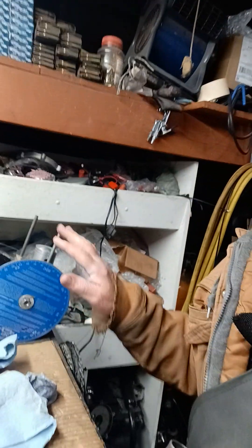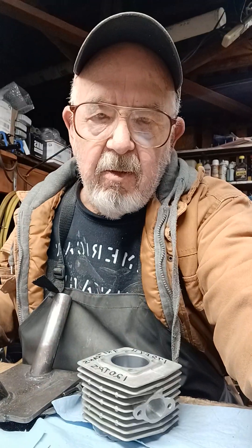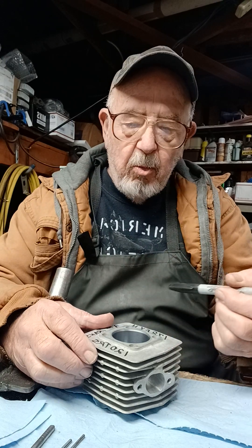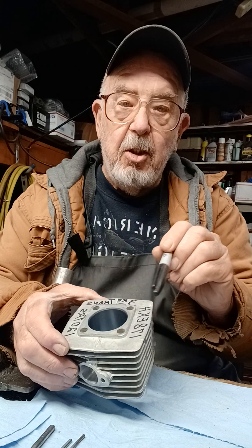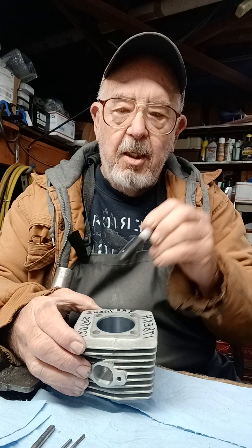The first place is with a degree wheel. You've got to do the degree wheel on your cylinders. The first thing you've got to do is mark with a sharpie where you want your exhaust cut to be at the degree you want. When you get that exactly where you want it, mark it down.